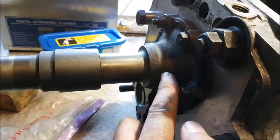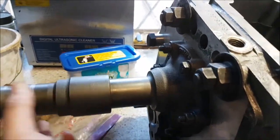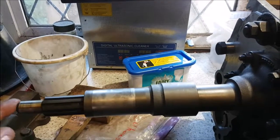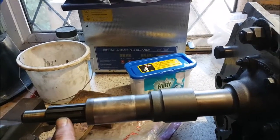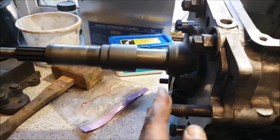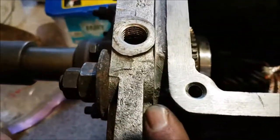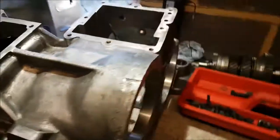So what I need to do — at this end we've got the oil pump housing. So the input shaft and the oil pump housing: the clutch release bearing slides up and down this bit here, that bit goes into the end of the crankshaft, that bit is what the clutch plate slides up and down on, and the bell housing fits onto the end here through these bolts. So I've tightened this up enough so the gasket's in there.